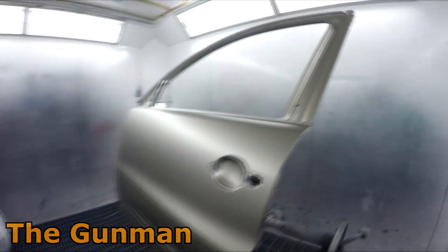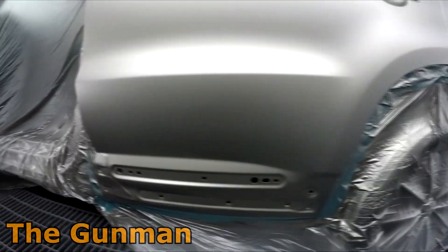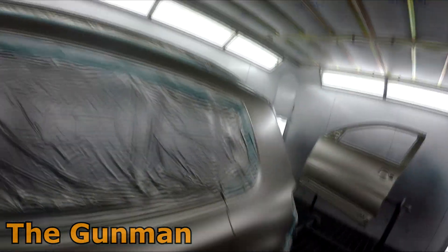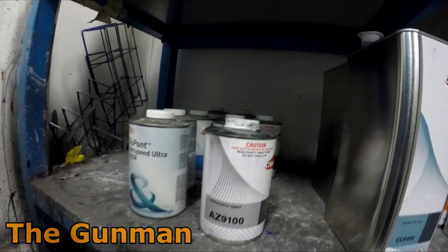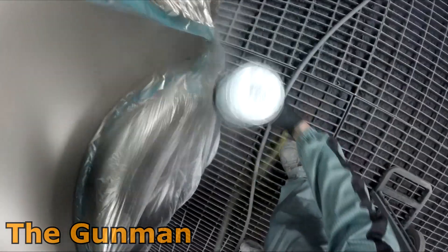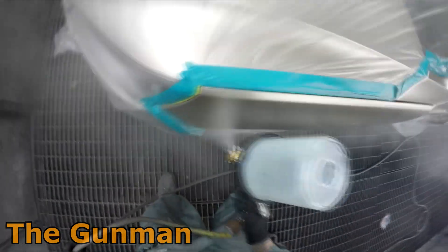This is when it's just about ready to clear coat. You can see just in some of those edges it takes a touch longer to dry, so you can get one of those air blowers. You do have to be careful that you don't go and skin it over and be left with sort of a puddle underneath it where the top is dry but underneath it's still wet, because that will lead to big issues. The clear coat I'm using is the CC6400, XK205 which is a low emissions activator, and then AZ9100. They call it a performance agent - it's not thinners - I think it's probably something to do with emissions.